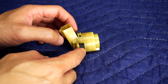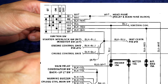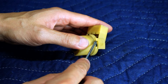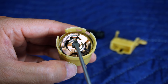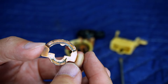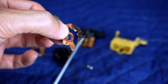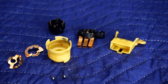Let's take a quick look inside this old ignition switch because I'm a little curious what's going on in here. They say that a lot of switched ignition power goes through this thing, so if it's failing, a bunch of things could go wrong — like your instrument cluster, radio, windows, and lights are all powered from it, and if you connect aftermarket gauges, USB plugs, and other accessories, they're all coming through here. Prying it open, we can see it's a mechanical component with what looks like sliding copper terminals that contact each other. Notice the dark stains or streaks on the terminals, which must be some kind of contamination or wear over the many years of service. There's even small terminals with some greenish corrosion growing on them. It's in pretty good condition, especially considering the ones I've seen that are completely burnt out or melted. Check out the Miataman YouTube channel — he's got a really informative video that goes in depth on refurbishing these things. Link in the description.